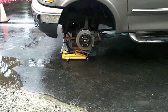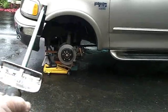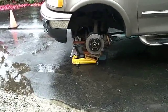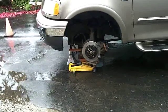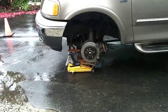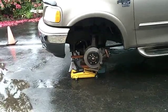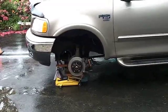136 foot-pounds of torque — that's a lot of pressure. I had this long-handled torque wrench and it took everything I had to get it up to 136 foot-pounds because there's only a certain amount of clearance in there. It's much easier to do it now before you put the calipers on. When you put those brackets on, just put them in finger-tight first to make sure you're not binding on anything. Once you're confident it's fit properly, then you can hit it with the torque wrench.